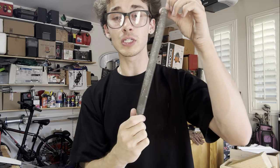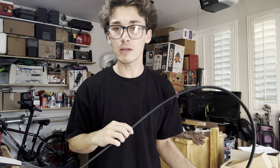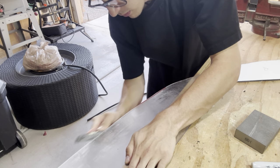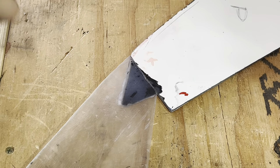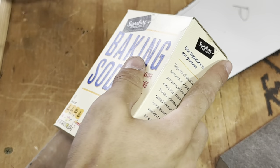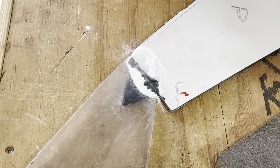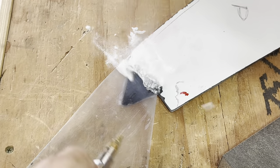This file right here is a lot stronger than the material we're going to be cutting into, which makes it great because it will cut exactly the amount you want without having to use power tools or dig any more than you need to. We're also going to be using a sanding block to get those fine little micro details where it's not cutting as deep as a file would. We're also going to be using this cord-like piece as a template so when you sand around a curve you can tell where the high and low spots are.